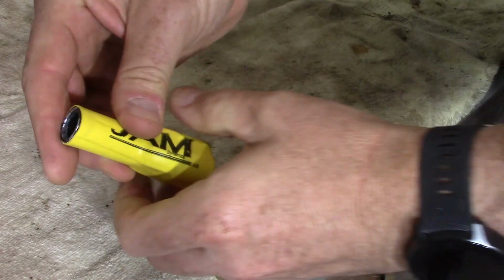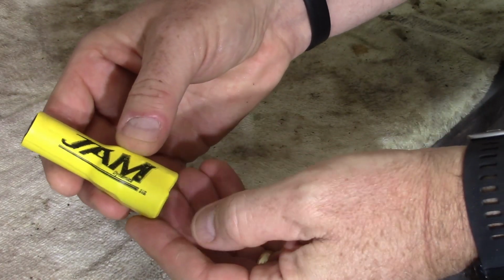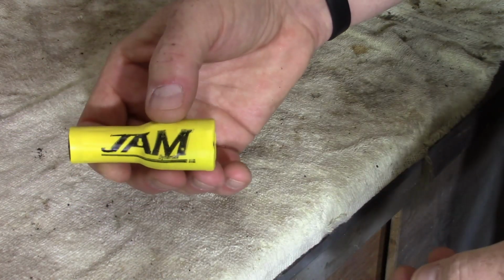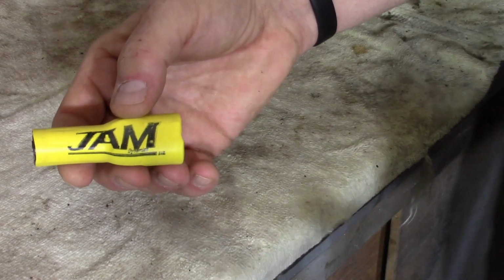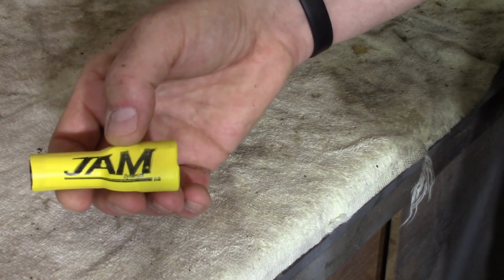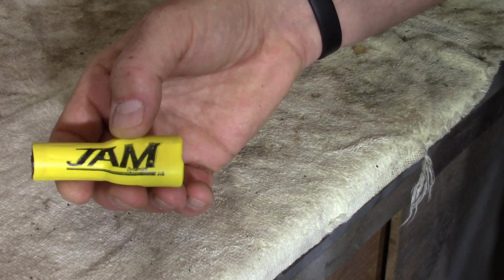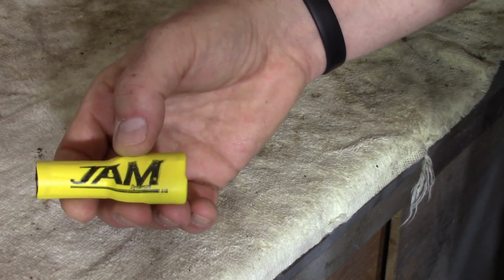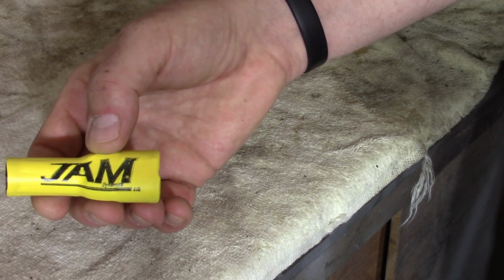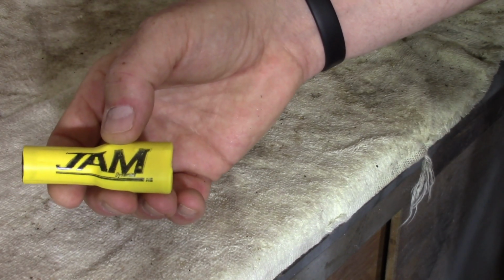and lock on top of where the prop rod articulates, and it locks the upper and the lower halves of the prop rod together, and that's what prevents the prop rod from breaking and bringing the bonnet down on your head. Pretty important, especially if you're working on the car and moving around and not really paying attention to where the prop rod is, and you might hit it the wrong way and break that away, and now you've got this bonnet coming down on top of you or on top of the car, chipping paint and denting stuff and everything.